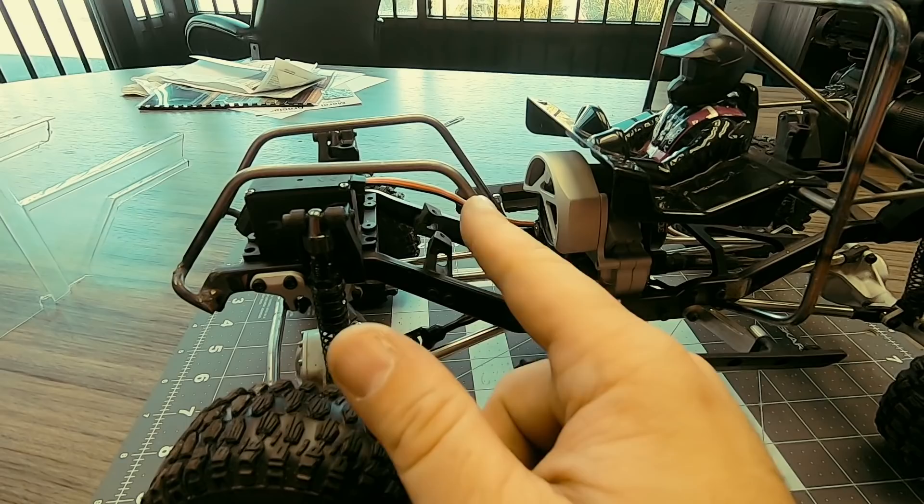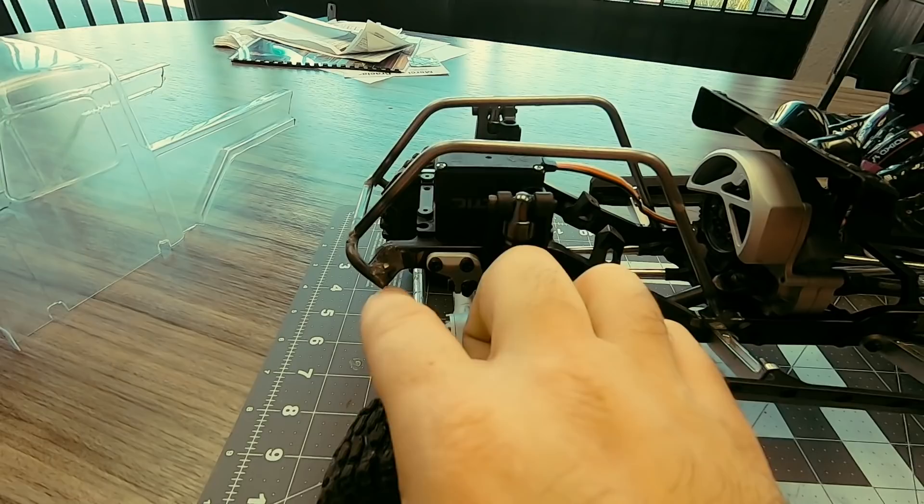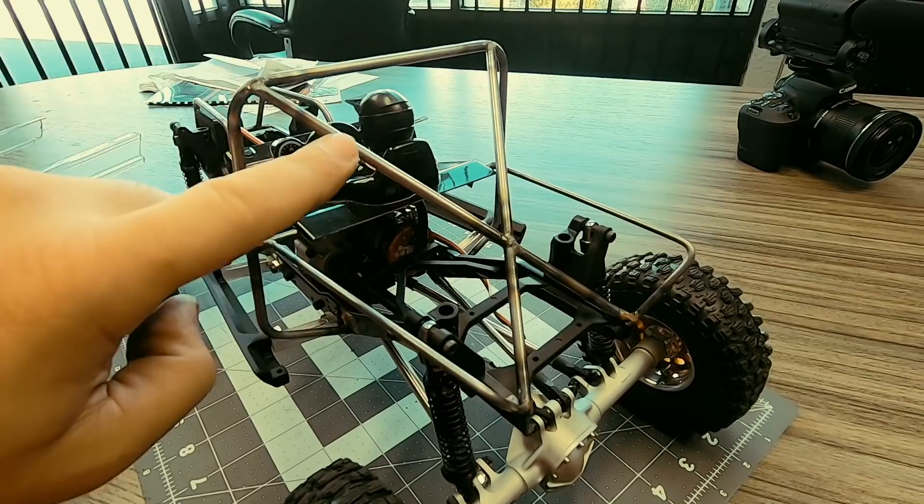It's not really needed to brace this front bumper — it was more for fun than anything. These bars are 1/8 inch, and this is 3/16ths DOM tubing that I got from Stock Car Steel. It's expensive to ship and expensive to buy. For some of the minor bracing I'll use 1/8 inch. I've got some other stuff to do back here too.